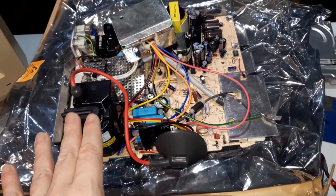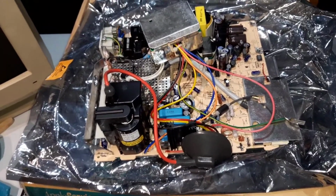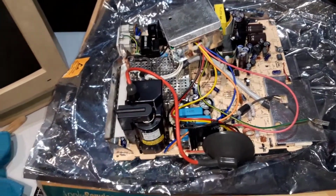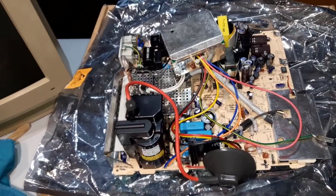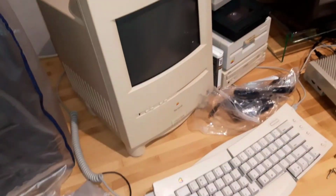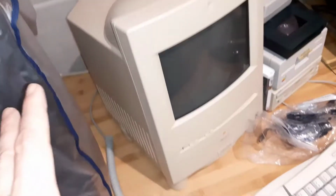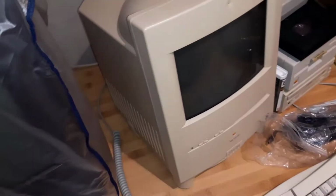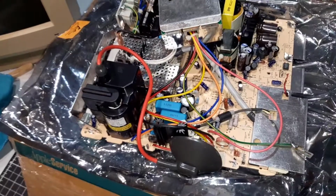And this is basically to show how rare those Color Classics are becoming. They are really becoming rarer and rarer with time, and especially more difficult to find working ones. Anyone who works with refurbishing old computers, especially Macintoshes, knows about that. So yeah, it's going to be nice to give this little guy here a fresh start. It's going to revitalize this guy a little bit. The logic board is already very new. This guy is using the Mystic board, so it's good to go. It's basically just replacing the analog board. The CRT is also in good condition.